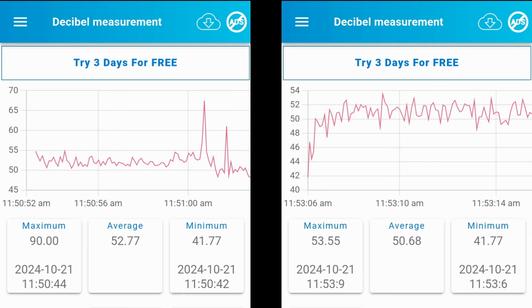Now, it does have a case, so I basically put them the same distance away from each other in terms of the GPU and the case, so I would think that they're pretty accurate. But you can see that the blower fan is very quiet. Now, like I said, because it's turned down so low, your GPU is going to run pretty hot, and my 4090 in my case runs with the fans at like 20%. It basically runs at like 65 to 68C, which you really can't ask for better temps when you're gaming. But yeah, you could see that it is very usable, and you're not going to make everybody go deaf as long as you keep that fan low on the 3080.